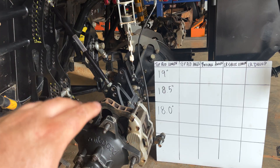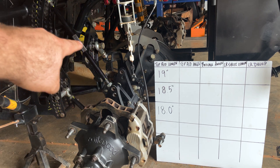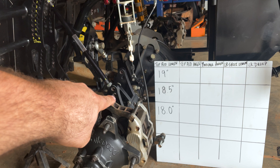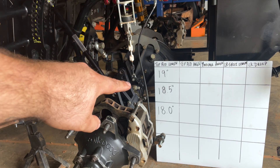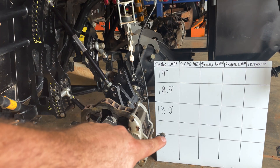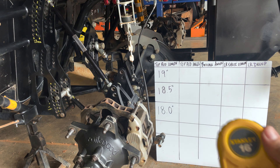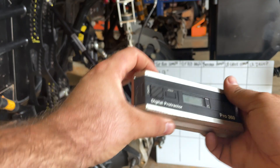We're looking at the left rear here. Here is our birdcage. We've got our top rod — that's the rod we're going to change. The bottom rod will remain the same. We're going to check the angle on this surface of the birdcage, check the angle of the rod, the droop from the frame rail to the axle tube, and the center-to-center on the left rear behind shock from that point to the mount on the chassis. We've got a whiteboard and a couple of tools — a tape measure and an angle finder.